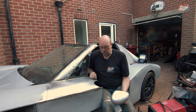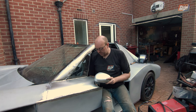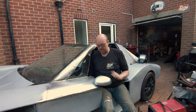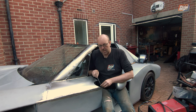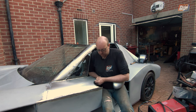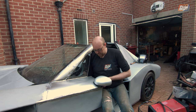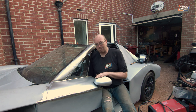We've got the cutout done and we did go a little bit overzealous — we could have gotten away with not trimming quite as much around this edge because it drops away from the bottom of the mirror. But this now fits in really quite nicely. If I pull these bolts through and put a bit of tension on them, you can see roughly where the mirror is going to line up into the bodywork. We've got some edging — the same edging used on the inner arches — that fits around the inside edge, and with the bolts back through and a bit of tension on, that is an almost perfect seal. We just need to add a little bit more across the bottom, but otherwise this is basically installed.